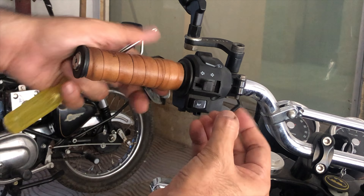This whole process should not take more than an hour. The way I went about it: I first removed the mirror assembly from both sides, then just loosened the switches on either side, because the switch wouldn't come off with the handlebar still installed — there is not enough slack in the cable. Before you start disassembling the handlebar, I'd recommend putting a cloth or towel on your petrol tank to ensure it doesn't get any nicks and scuffs.